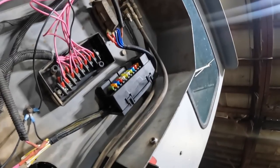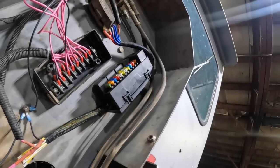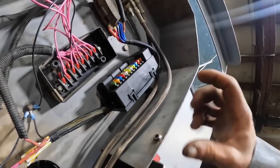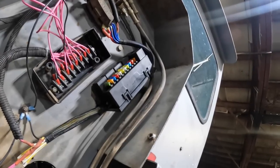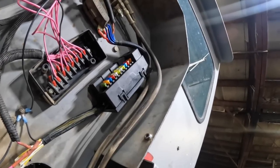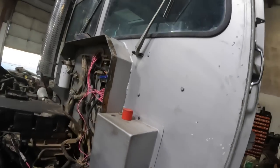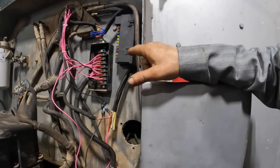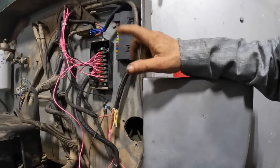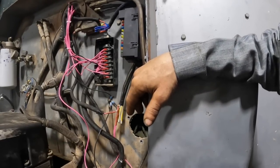I don't want to cannibalize my relay box. I'm thinking about just getting my own relay for the start - wire it in here somewhere so I don't have to cannibalize the relay box. They're all jumpered coming straight off the fuses to pin 30. I'd have to cut it back in here somewhere and do that differently.